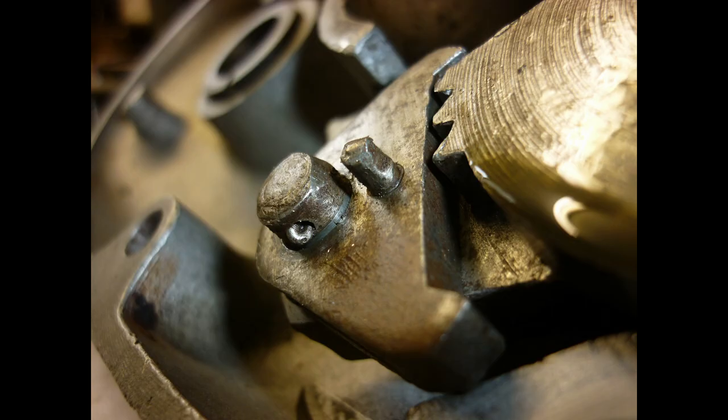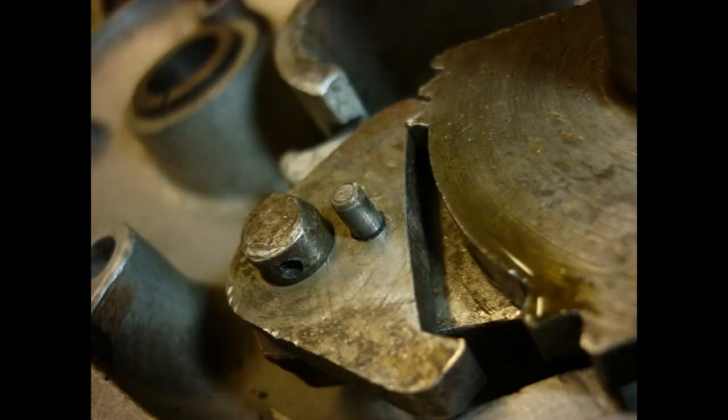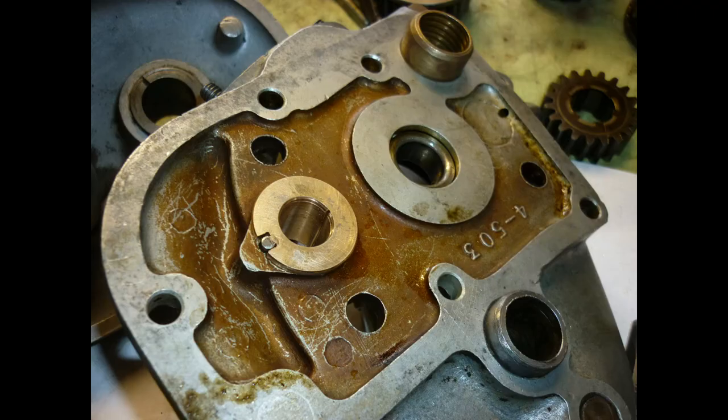The gear change shaft will also benefit from a new bush. With the mechanism assembled, the spring tends to jump off this pin. Perhaps we have discovered the origin of poor selection, which led to further abuses and put this Red Panther into the dark for over 60 years. It proves easily repairable, driven out and replaced with the shank of a broken 1/8-inch twist drill. I told you not to throw anything away.